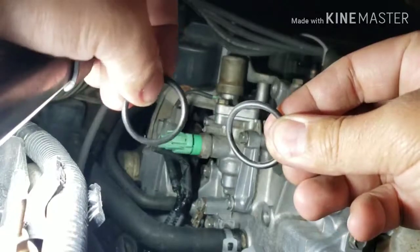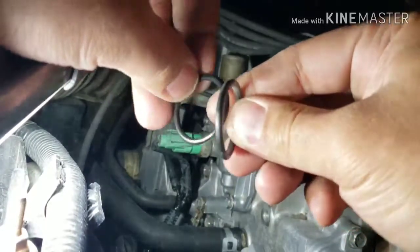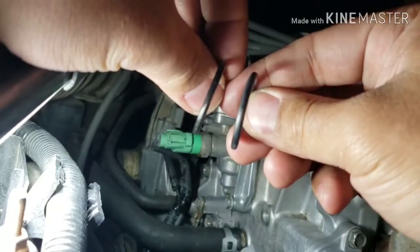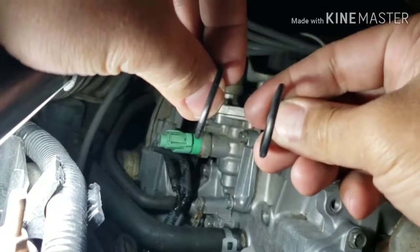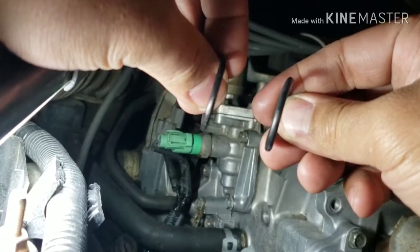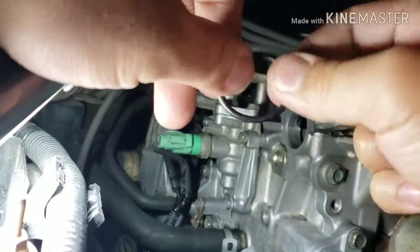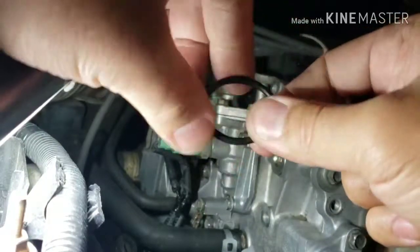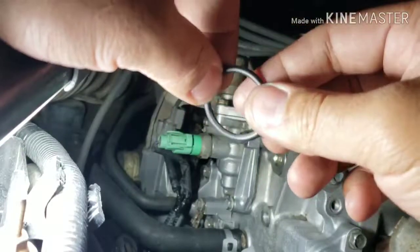The one on the right is fatter by the feel, and I don't know if you can see on the video. If you look at it a little bit, yeah, you can tell that the one on the right is bigger, fatter, with more rubber on it compared to the aftermarket. I got this from Amazon. It's a kit, like a head gasket kit. It comes with this, so definitely get a Honda one. It's like $5.